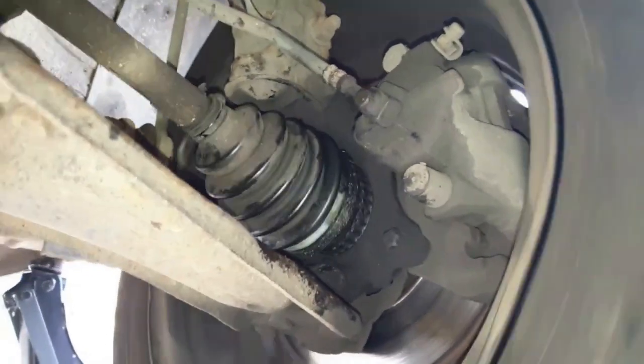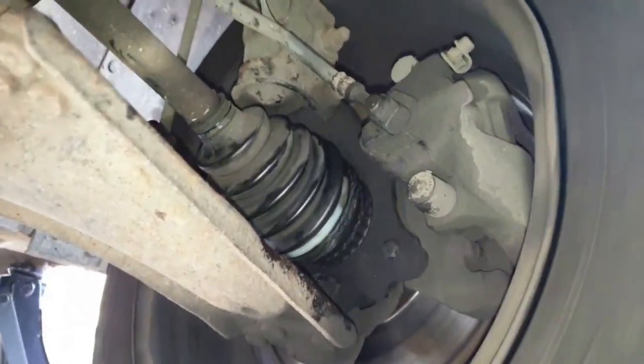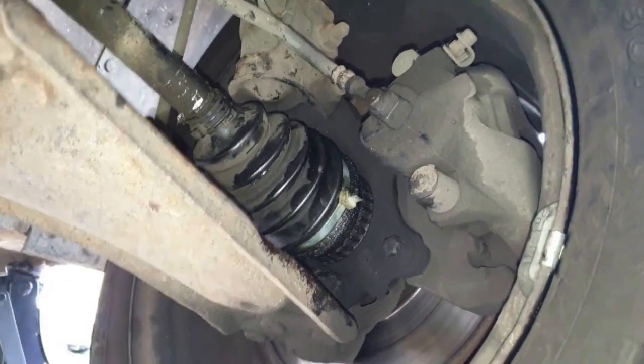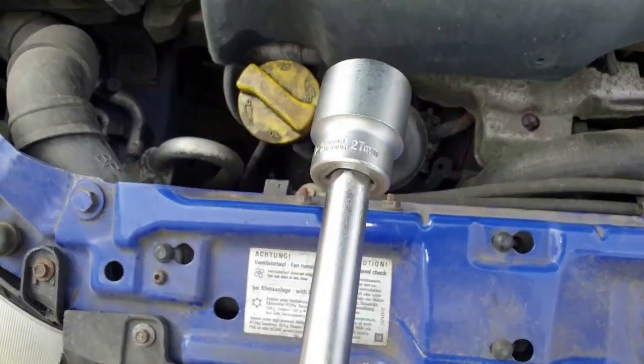This is just to try and keep the CV joint in some bearing grease until it can be repacked and a new boot and clamp can be fitted. There's a cable tie on the narrower end, but these should really be secured with those single-use metal bands.